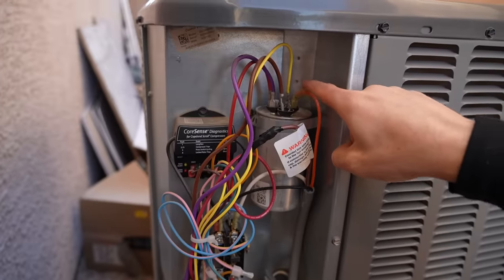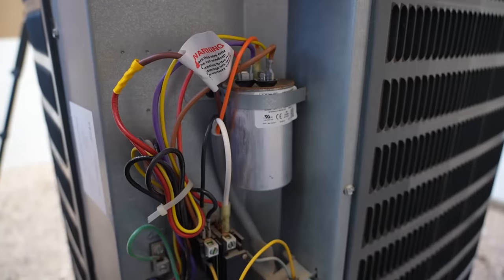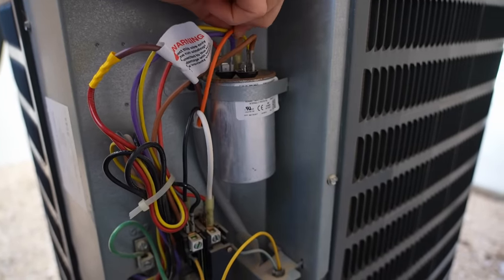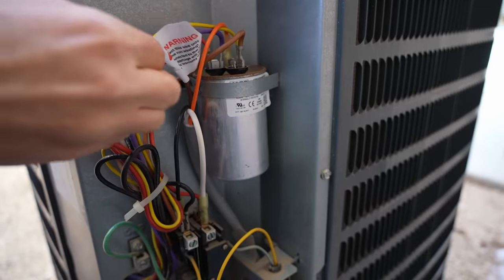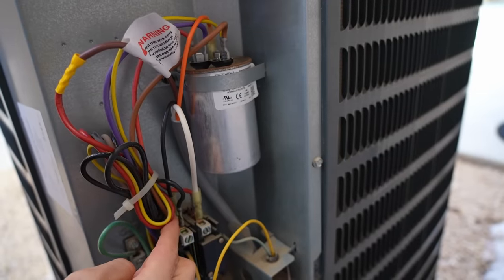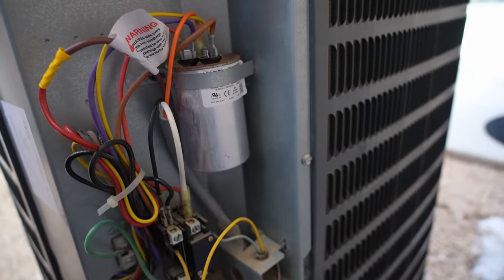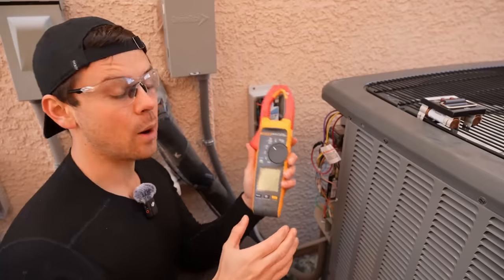You can also buy an installation kit that comes with the spade connectors, so if you don't have these around your house I highly recommend buying that kit. On the second unit it's slightly different but the same principle: find the yellow wire and connect the orange wire there, find the red wire and connect the brown wire to it, then the black goes where all the other blacks are, and the white goes where the red wire runs up to the capacitor. That's pretty much it — add the cover and give it power.